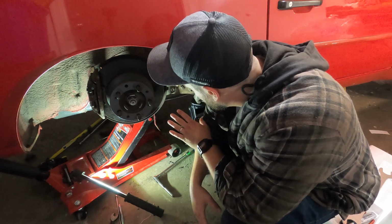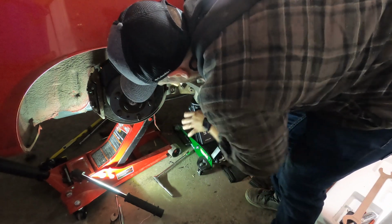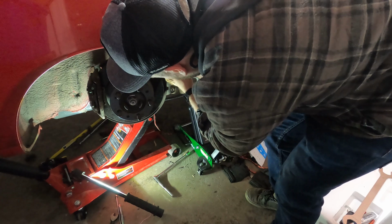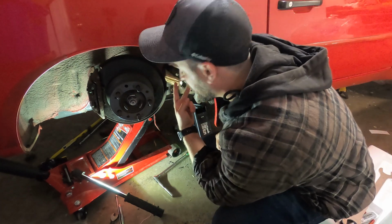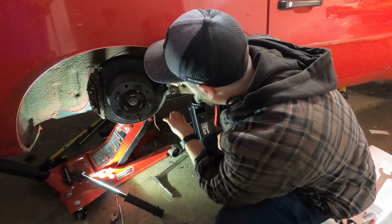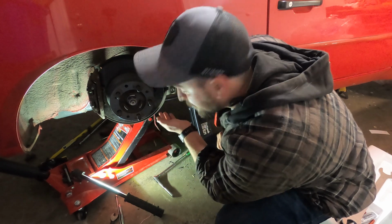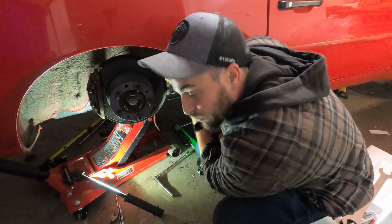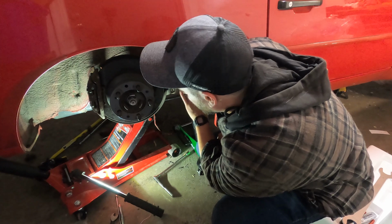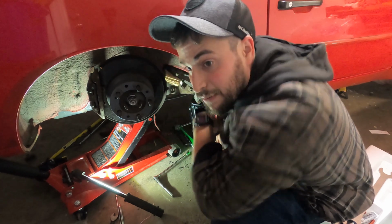Basically what I've had to do is, once you get the bolt back into the body for the entire torsion bar, there's another mounting point up here, and there's 2 bolts that go in and a rubber hanger. And basically once you drop this, I dropped it in the middle with the jack and brought both sides down and then jacked it back up that way. But everything is kind of hanging at an angle. The center of gravity is behind the torsion bar when you have everything bolted up. And it's a real nightmare to get back together.